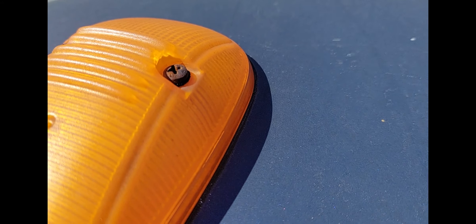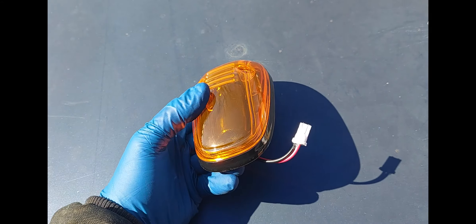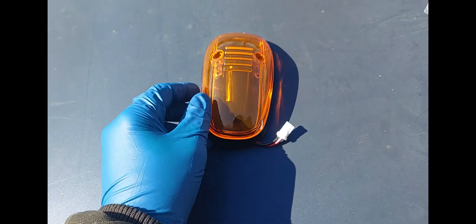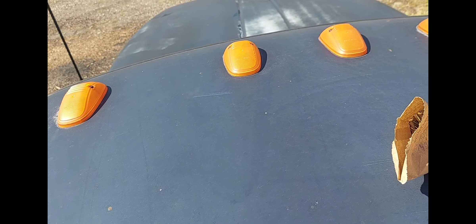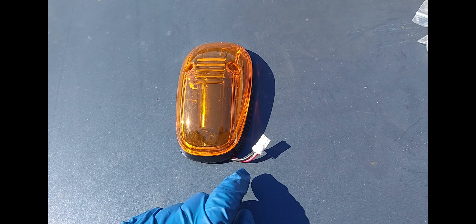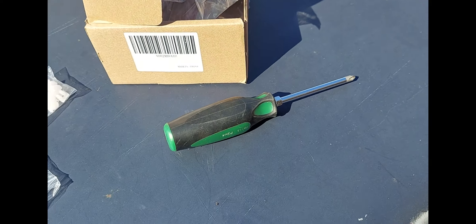New O-ring and old screws - I did not have stainless steel screws at the time, they were in that bag. So these will get stainless steel screws. As much as I would like these to be DOT legal, I'm kind of in a state that doesn't really matter - they don't pick on you about stuff like that. I have put LED bulbs in these, like the 194 equivalency bulbs. Anytime you're doing LEDs they actually care which one's positive and which one's negative, so make sure you put them in the appropriate way.